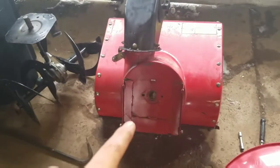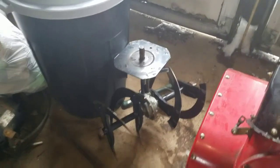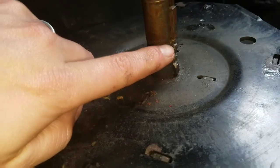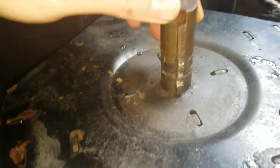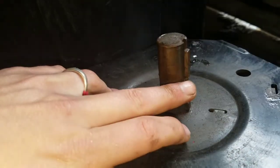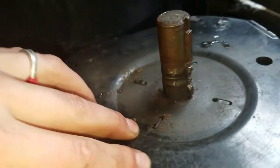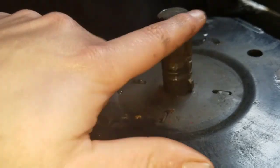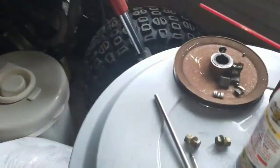Okay, that's all taken apart, cleaned up, the shaft off. There wasn't anything behind it. I do have, in focus, the keyway on here is all chewed up from the bearing being bad. It does only engage this top section here. So what I think I'm gonna do is pull this out, take the grinder, lop it off there, because all it has to do is engage that pulley there. That's the bearing. I don't know.